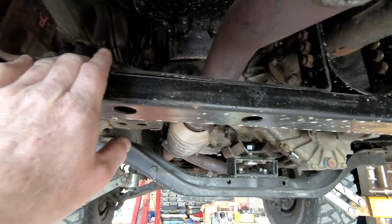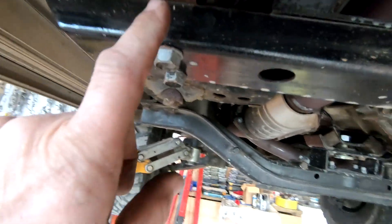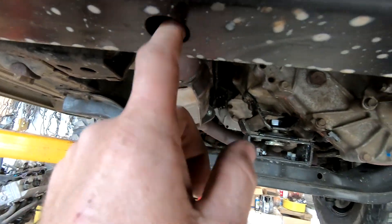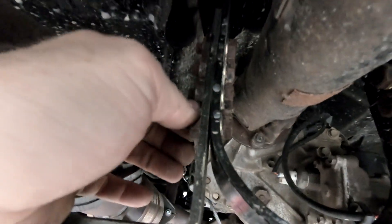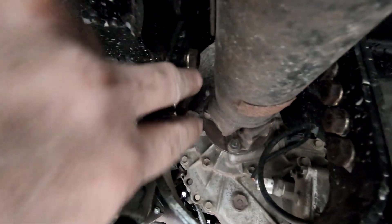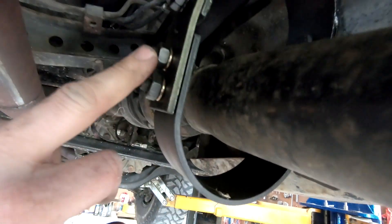When putting these in, you need to really look at best practice. Things like through here, there is a crush tube. I just whip holes through the center here so it's nice and simple to put the bolts in. I use the same bolts that come with the drive shaft hoops because they're the right ones. Be careful with your bolts up through here that they don't touch your drive shaft — that's why I go from the inside out.